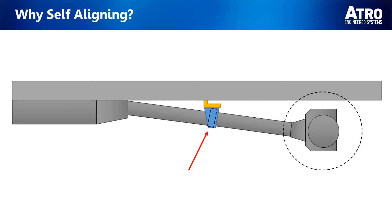Now, in this last example, note the bracket is again 90 degrees and parallel to the frame. But instead of using a wedge, the Self-Aligning Carrier Bearing is used. Because the center is allowed to pivot plus or minus 10 degrees, there is no need for a shim. This saves money and time on the installation because it has fewer parts, and there is not a need to be as precise due to the range of articulation provided by the new carrier bearing.